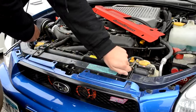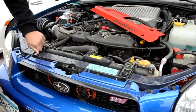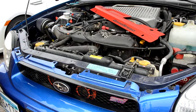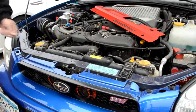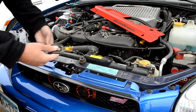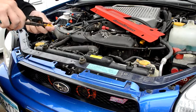This car is equipped with an aftermarket intake already, so the air scoop has already been removed. For that you would normally use the 10mm socket, but we won't be in this video. So grab your 12mm socket and remove the bolts from the two brackets for the radiator stays. And then pop the rubber bushings out of the radiator stays. And then use either your needle nose pliers or your screwdriver to pop out the prop rod bracket.